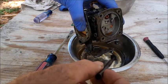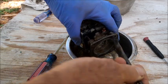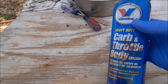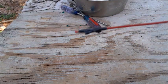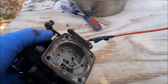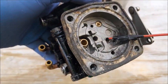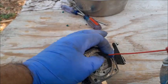I like using a little bowl with some gasoline in it and a small cleanup brush to clean up all the surfaces. We've got our carburetor cleaner — I like the one with the tube on it. I also like to take a little piece of electrical tape and wrap it around the end; that piece of electrical tape slides down to help seal up little passageways when I blow them out. We have several different jet holes right here — a jet here and a jet down here. Let's go ahead and blow these through to see if there's anything in the passageways.